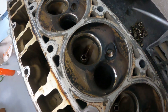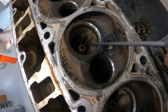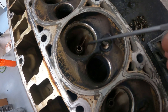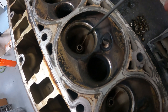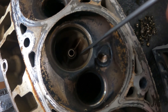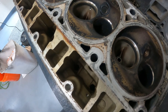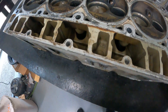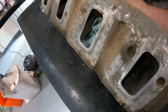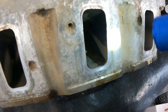For instance — you see the vein? You can see this darkening here. This is varnish. You can tell it's not entirely following the vein, but it's getting pretty close, so it tells you you need to work that better. Usually this pattern will be thinner if the vein is more appropriate — it'll be small. This one's a little wider because you can see the bulge around here. If you knock that out, this will get reduced and it'll follow that contour better. It's pretty dirty, as you can tell. But I've seen way, way worse. And you can see all the carbon in the port.